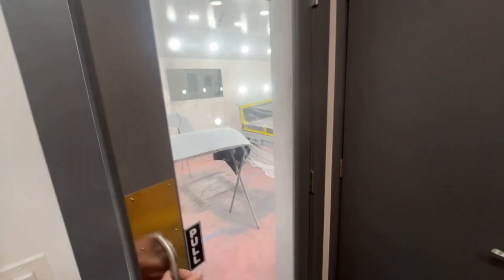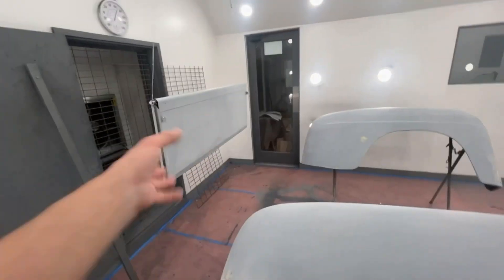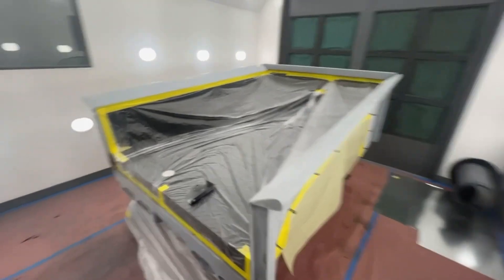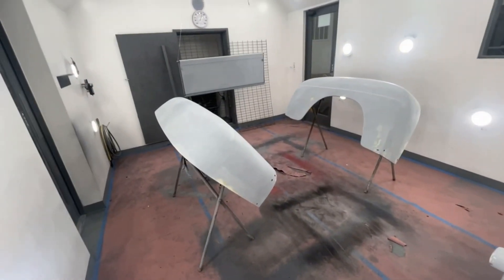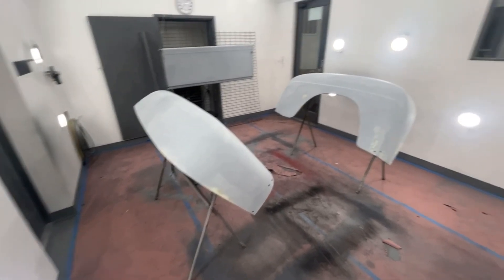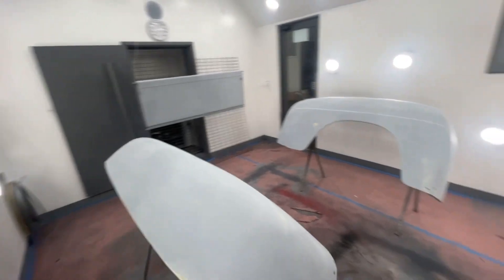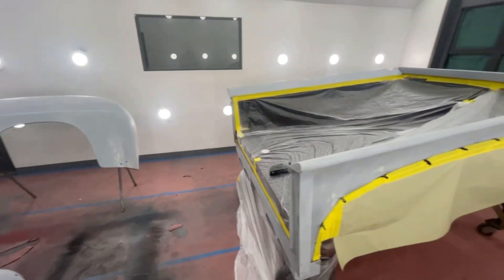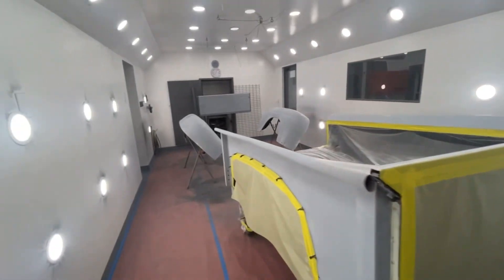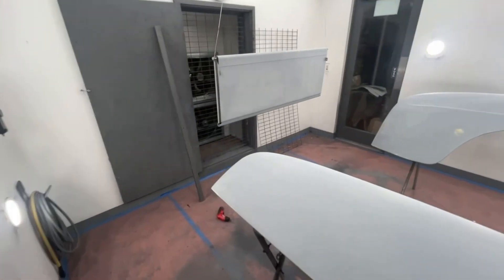Hey guys, just making a quick video — it's nine o'clock Monday night. I just got all the parts hung in the spray booth, got the bed taped off, and ended up doing quite a bit of bodywork to these panels. I'm going to spray epoxy primer on any areas that have body filler showing, and use it as a sealer overall. Remember, this truck's getting painted twice, so if anything looks rough after this first paint job I'll fix it on the next one, then re-clear it with the truck fully assembled.